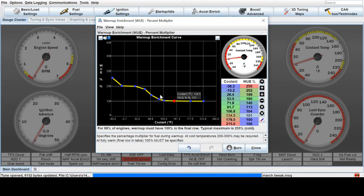The areas you want to mess with are usually when it's cold — when the motor's maybe under 100 degrees Fahrenheit. There's a general curve they give you when you make a tune in Tuner Studio, but this is what I've had to come up with to start my car in the morning. I don't have an idle air control valve, so I have no way to get extra air in. If I don't have at least 200% extra fuel, it really just doesn't want to start at all. But if I give it at least 200%, it'll fire up pretty easy after just a couple cranks.